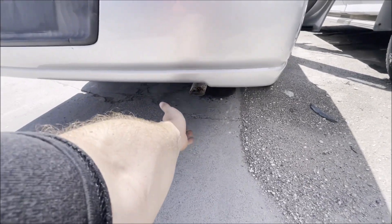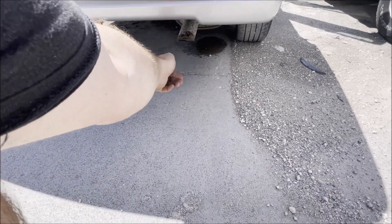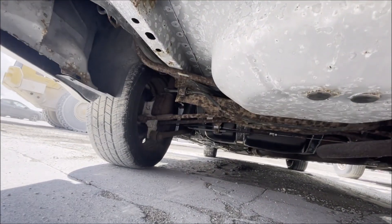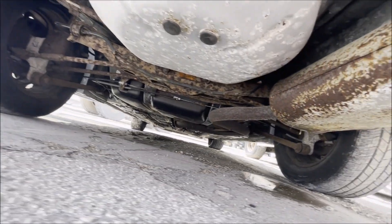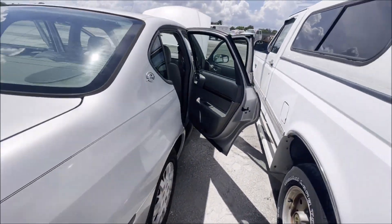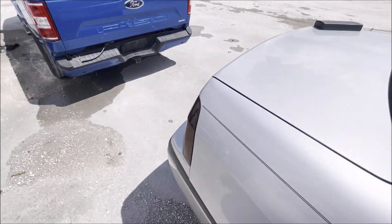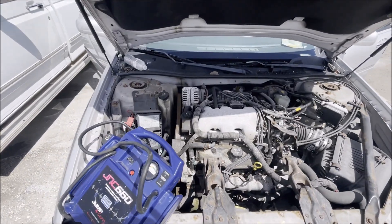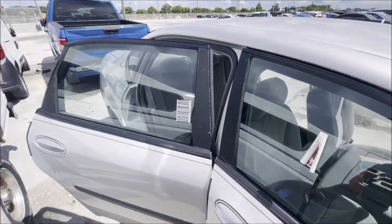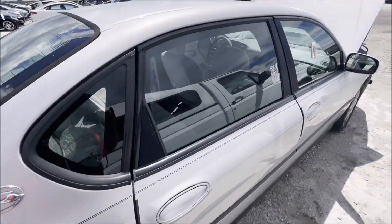A little bit of - I didn't want to call it white smoke, it's just really moisture, especially from something that's been sitting this long. Let's look underneath it. This is very rusty for a supposed low-mileage car. I see all the moisture coming out of the muffler, dripping out the little drain hole. That's why you have all that smoke. I don't think this thing has a blown head gasket or even bad intake gaskets - it sounds like it runs pretty well. But because of the undercarriage rust, this was sitting in like a swamp, and maybe the water got up high.